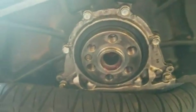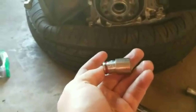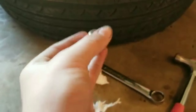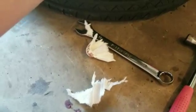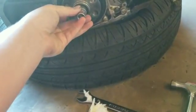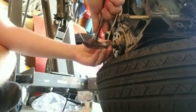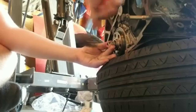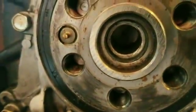Now it's out of there. Just try to clean up the surface inside of there and press on the new one. So this 10mm fits right inside of here — I'm basically just going to set this inside like this and then hit it with my little pink hammer and it should pop right in. Alright, you can see our pilot bearing is in there now.